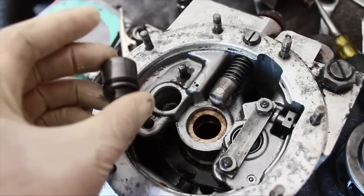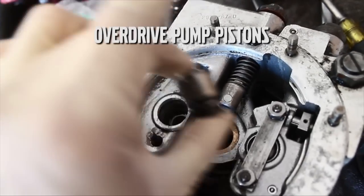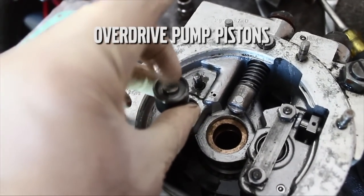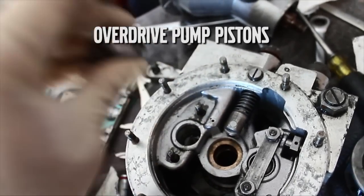There are two O-rings that come with your kit — actually there are about five O-rings total, but at least two of them: one is here and the other is there. Remove those bolts — they have little locking tabs. Then use a magnet; if it won't come out with a magnet, grab this little centerpiece with some pliers. Be careful not to damage it. Replace that O-ring, stick it back in, call it a day.